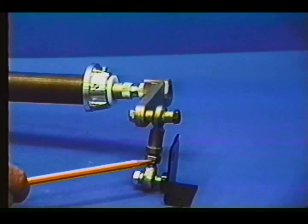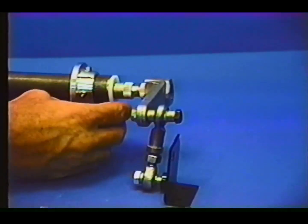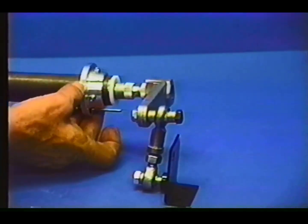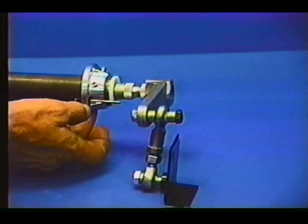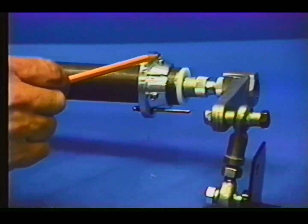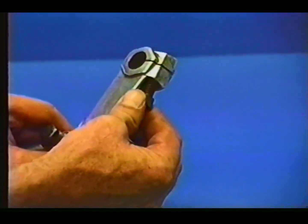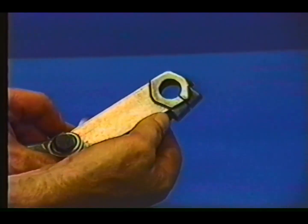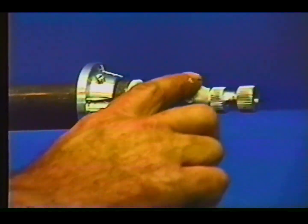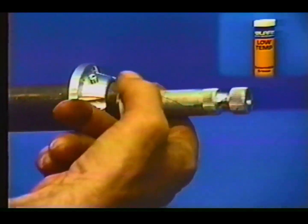Very little maintenance is required. However, periodic inspection of this aluminum support area, the set screws, and the mounting rivets is required to prevent loosening. One other item to keep in mind, very important that the bar arm pinch bolts are kept tight to prevent arm to spline loosening. Periodic lubrication of the bushing and the shaft area is required. Use Polaris low temp grease for this application.